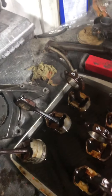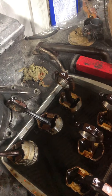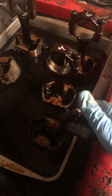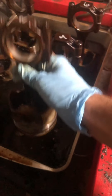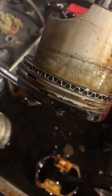I'm still waiting on the machine shop. If my block's not good enough for the build, I'll take the input to run a 3400 bottom end, because you get the roller cam and all you'd have to do is swap out pushrods and do some wiring to the ECU — nothing big. I don't think my block's bad though. I checked the bores and they all look stock — like it was never bored. Whoever touched this motor just re-gasketed and ran it.